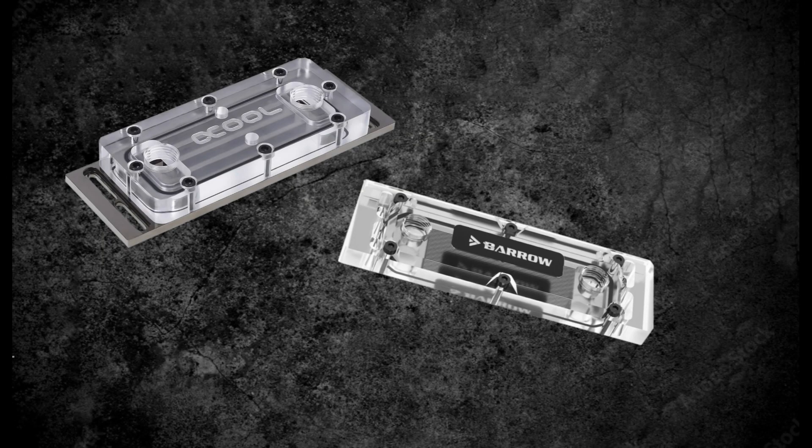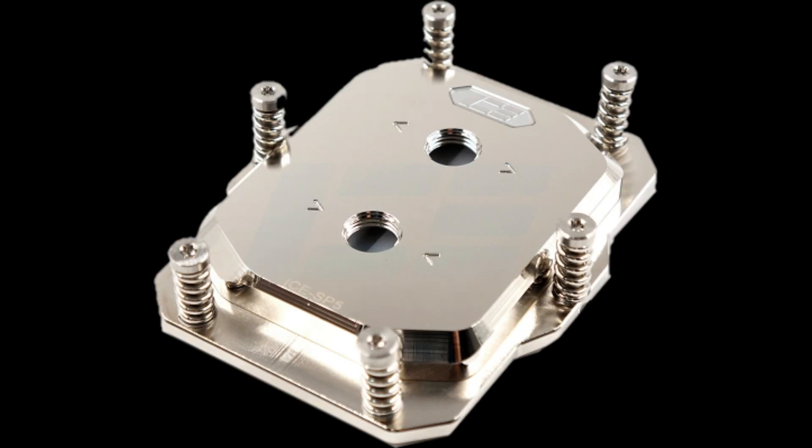I did need to cut off the sides of the block to get it to actually fit into the chassis and have a way to be pressed into the heat sink, similar to the alpha cool. It was just a little bit of cutting on the outside of the o-ring, so no issues there. Slapped it in, had pretty good gains, but then I also started looking into server CPU water cooling blocks and came across this Iceman block for an AMD SP5.